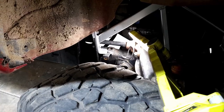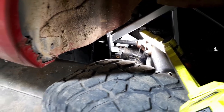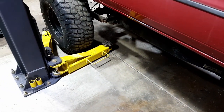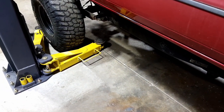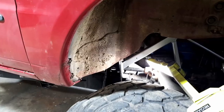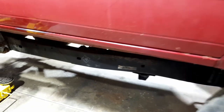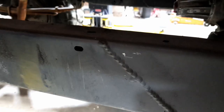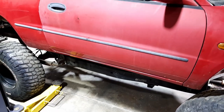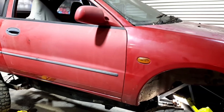And anyway, so I'll continue with the brakes, and I'll get that long line, because I'm only going to use one of the rear brake lines coming from the diff, the flex line on the diff, and then I'll run it all the way up here, see where it goes, because it's going to be 400 mil shorter. See, there's a joint in the chassis there, I cut and shut the chassis 400 mil shorter to accommodate this little beast.